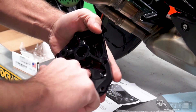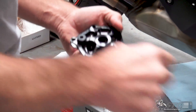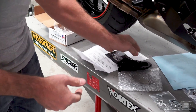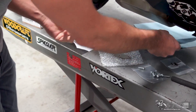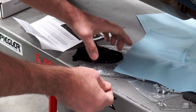They want you to lightly lubricate one side of that O-ring just to ensure that it doesn't tear. So what I'm doing here is just a really thin coating — just enough so it kind of slips when you tighten it up instead of grabbing. This is just a little bit of general purpose grease. Don't need to be too scientific here, just get a thin film in there. Right now we're just prepping the cover to get it ready for install.